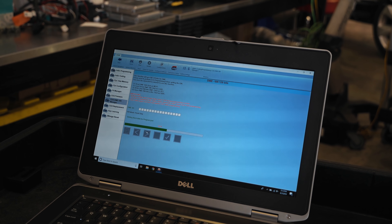There's my original ECU just sitting on there. Huge thanks to Wren — they really bailed me out here, and I'd love for you guys to support a local business in Houston. If you guys need this work done, I'm going to ask him how much he'd charge if you were to send in your module, or if you're local to Houston just pop in and it'll be an easy upgrade. From what I understand, before it can even pull the ISN it has to write to the ECU. Even though I have comfort access, the software would not allow programming unless the key is physically in the dash — comfort access is not acceptable, just so you know.